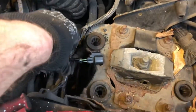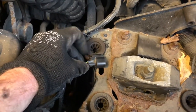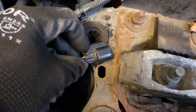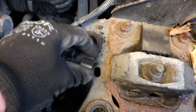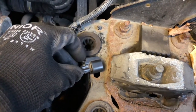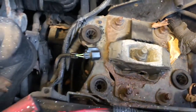I've just got the electrical connection off. This is one of these clips where it has a little tab at the top, so you have to reach in — just on the top of the connector there's a little tab, push that in and then pull up. If you don't know that's there it's going to be very fiddly. It's not one of those squeeze ones. Just reach in, push that little end tab in and pull it out — that'll save you a lot of bother.